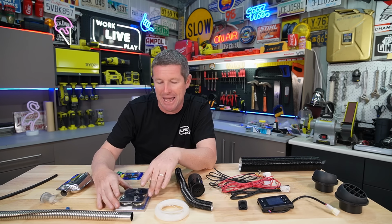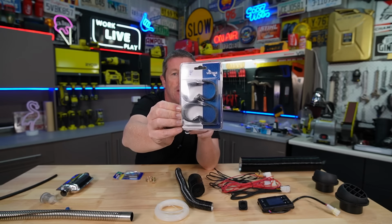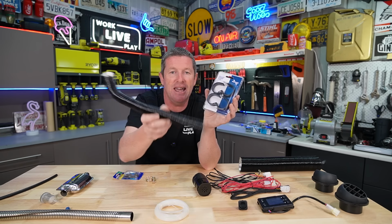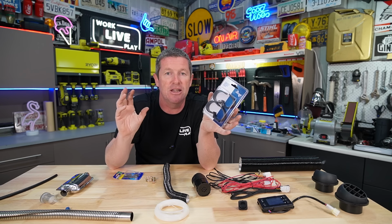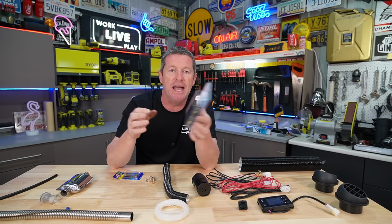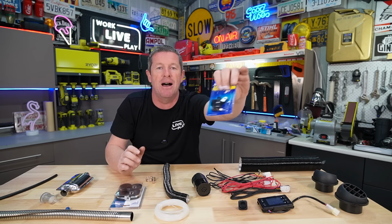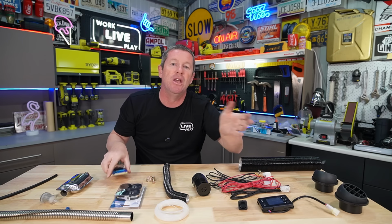And while we're talking about clamps, I've actually gone and bought these, and again, I'll link them in the description below if that's what I use. I'm going to use these for the intake. I just think the rubber mounting of these will be a little bit nicer than the standard steel ones that are provided in the eBay kits. I've also got some Narva P-clamps, which I'm going to use to mount up the fuel line and also the wiring if I need to as well.